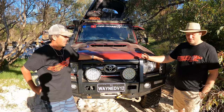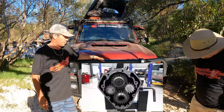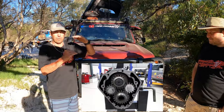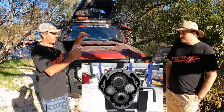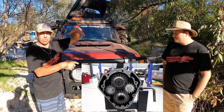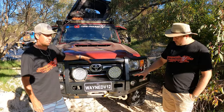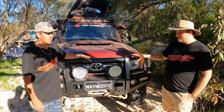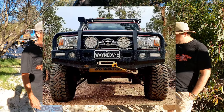So what does it mean that it's portaled? We'll put a little screenshot up in a minute. What the portal is, it pretty much gives you a genuine 4-inch lift — clearance under the car. Your axle comes in and goes into a housing where there's another gear that transfers down to the wheel. That gives you 4 inches, the tires give you another 2 inches, and you've got the suspension as well — another 2 inches. So it's like 8 inches all up.